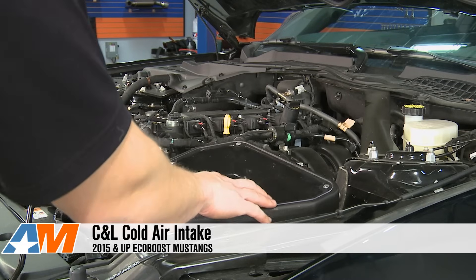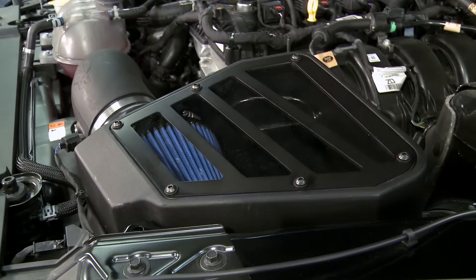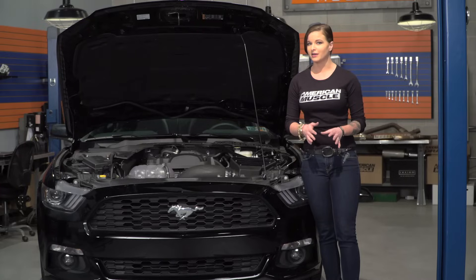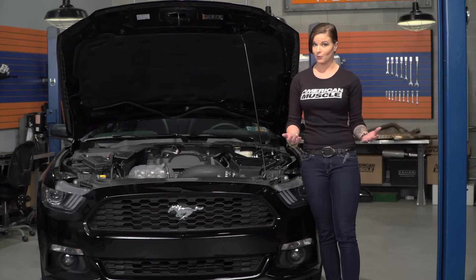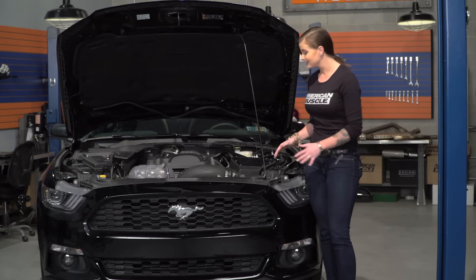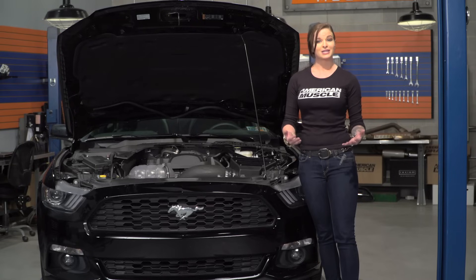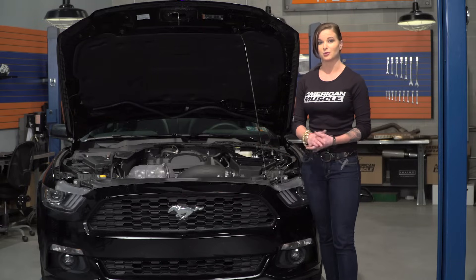The key to this design is the airbox. It's an enclosed airbox — one of the only on the market — with a removable lid so you can get to your filter easily. The enclosed airbox also protects the filter from elements inside the engine compartment, and more importantly, it helps keep warm air from being used by the intake. We saw some low intake air temps on the dyno. It also taps into the factory cold air duct, which brings cool air in from the grille instead of using warm engine compartment air — a benefit you don't see from many other aftermarket intakes for the S550 EcoBoost.